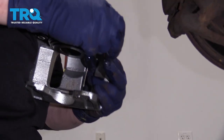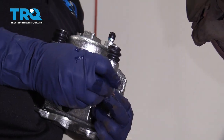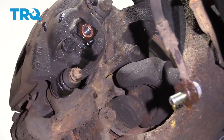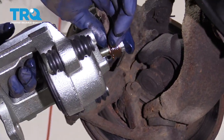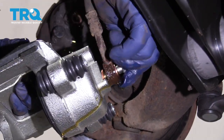First thing I like to do is apply the hose. So I'm going to put the new copper washer on the new banjo bolt, slide it right through the hose, and put the other copper washer on that. Then I can grab my new caliper and line up that flat part of that flex hose with the caliper — definitely before it gets tightened.